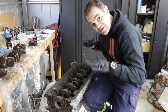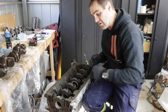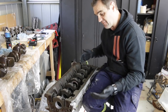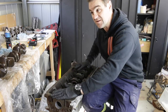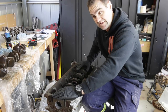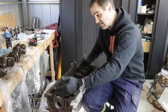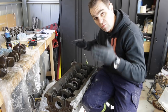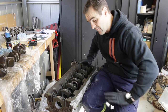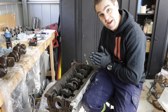I put everything in and torqued it up, then measured everything vertically all the way through and measured it against the crank. The clearances need to be between 0.033mm and 0.081mm, and we have 0.06mm all the way through. They're all super consistent — the crank is really consistent — so I'm very happy with how that is. Now I've got to pull it all apart again and look at putting this crank in.